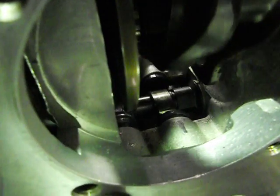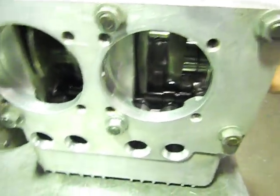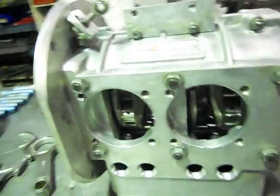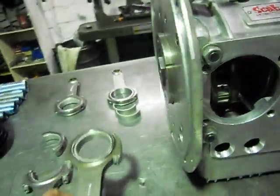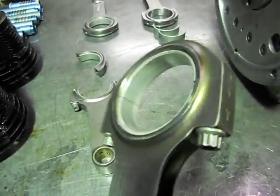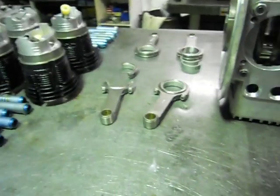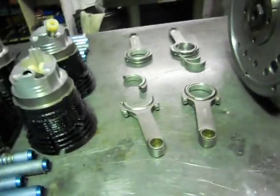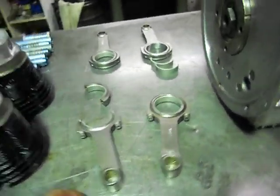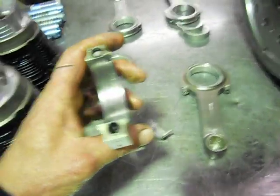This is a SCAT engine — just showing a look inside, a bit different than the last time we've seen it. We're going to put the barrels on it. We had a good look inside and all the connecting rod big ends were a bluish color. When a big end goes blue, it's heat, and the only way a big end heats up is lack of oil. We pulled the rods out and found that even though they were blue, the bearings were in pretty good condition — just about brand new.